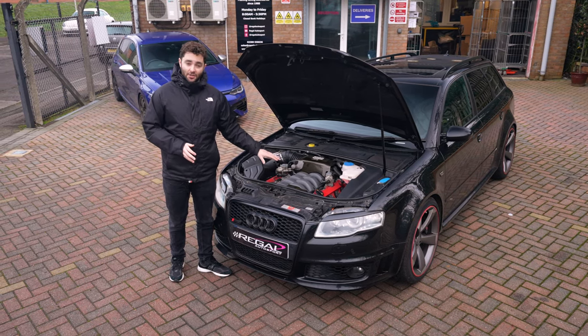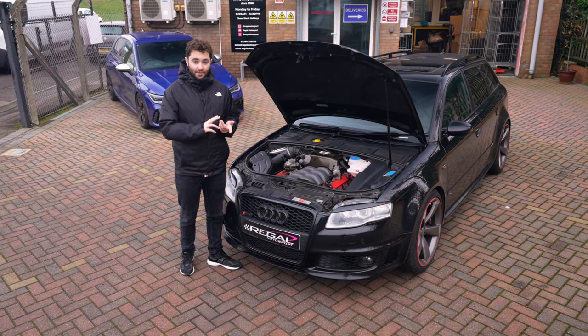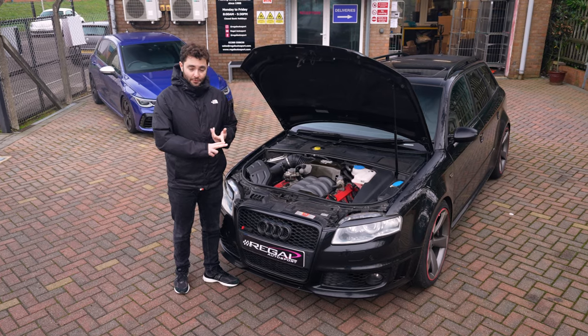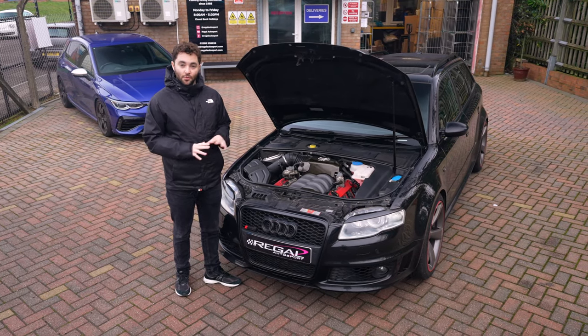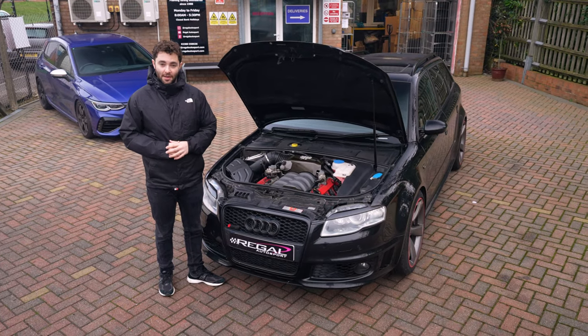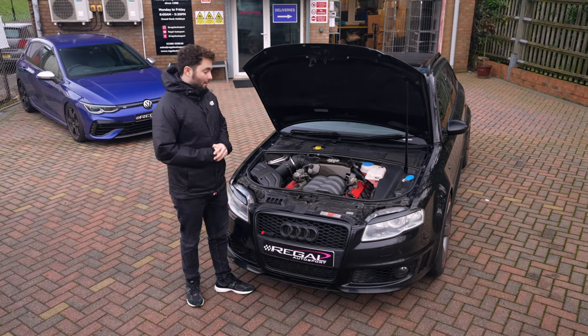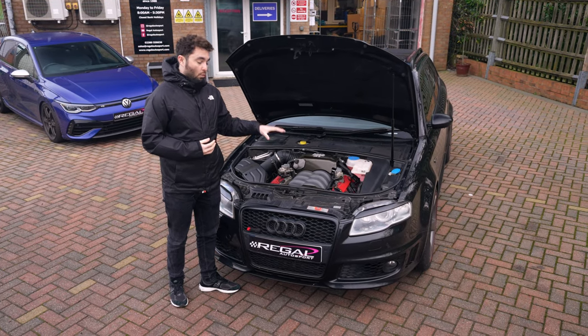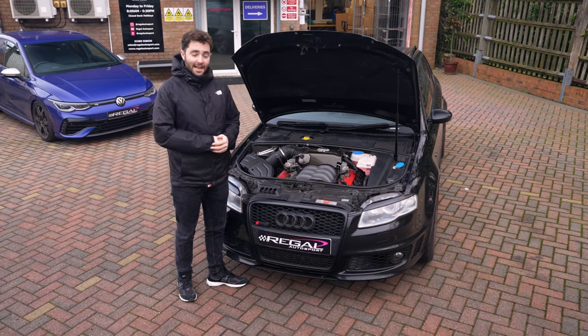So this particular engine over time will naturally start to block up on the valves, the intake ports and the intake port dividers. It is a lose-lose in all situations, and that's why we're doing this maintenance routine on this car. So that's obviously the why we do it. We'll get the car in the workshop and show you exactly how bad this car is.